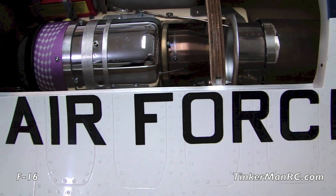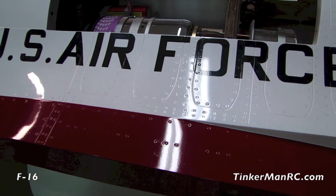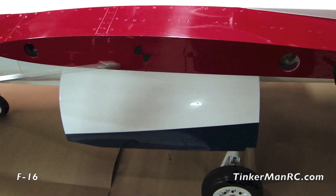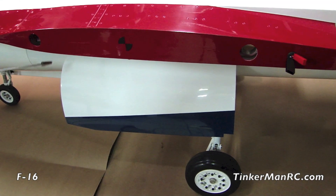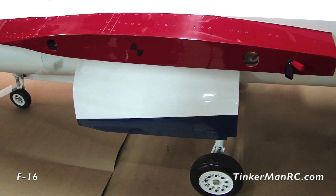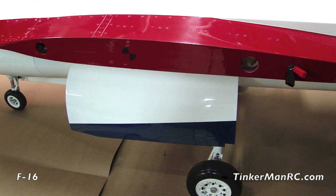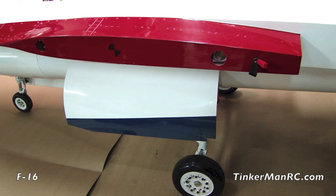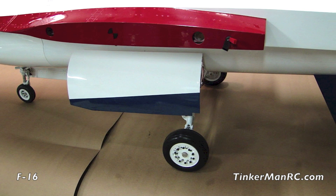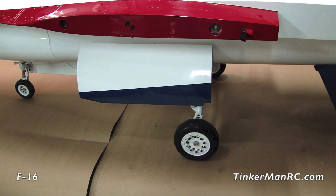Now we're going to put the wings on, show you the cockpit, close everything up, and show you the airplane complete. You can see the nice marking here for your CG, and this is where the wing gets installed. There are clamps underneath — inside the fuselage — and you access and tighten those clamps with an Allen screw on the bottom of the fuselage. The wings have forward and aft carbon fiber rods that slide in place, and obviously we have our lights and servo leads. Let's get the wings installed.